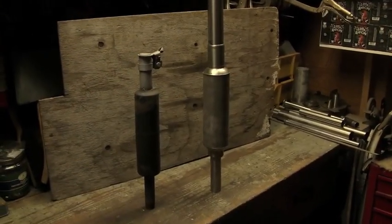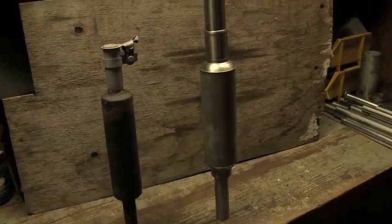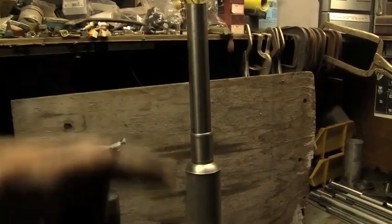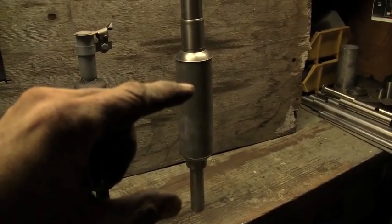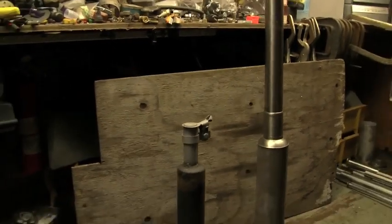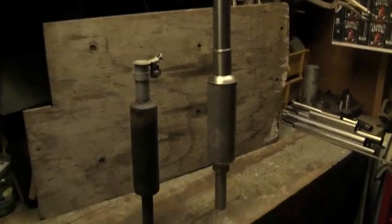That's exactly the profile I was looking for. This end cap weighs just over two pounds — 2.1 pounds — and the can is 3.95 pounds as it sits. I still need to add the stainless nip in the bottom, so that'll add a little bit. I need to figure out where this sits on the tractor, build it up to the can, and then check the fit while seated. The previous one used to come up and hit me in the face while riding, so I suspect I can cut about 60% of this pipe off, and then of course I'll put a little flapper on top.